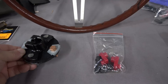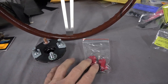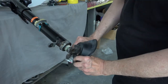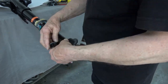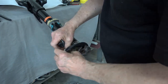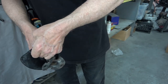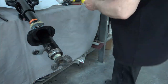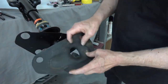The next thing is you have to install your rag joint. In my case I'm putting a brand new one on there — it's just better to put a brand new rag joint on, as it goes between the steering column and the steering box, and a lot of your steering wheel play is the result of a worn-out rag joint. Here I'm also reinstalling the rubber seal cover. I didn't disassemble the entire steering column, so I'm just forcing it around — I turned it inside out and forced it on there and it went on just fine without ripping.